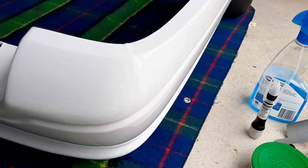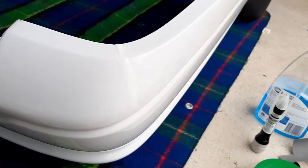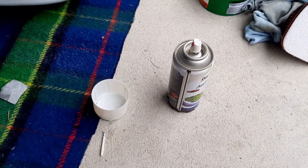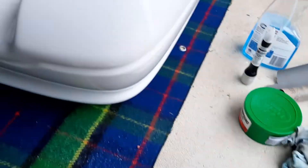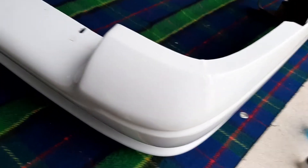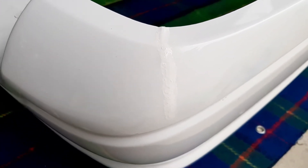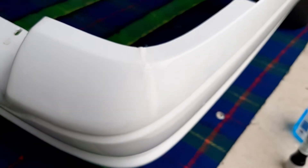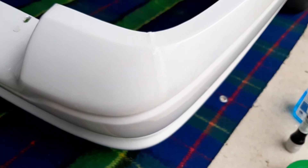The finished repair on the inside has about three cable ties and roughly six copper stitches holding it together. Give it a shake — it's pretty solid. On the outside I've cleaned up where the crack was and touched it up with aerosol — I spray it into the lid and use a little brush to apply it, put it on twice and hit it with the heat gun. In about five to seven days I'll hit it with 1000-grit until it's smooth and then polish it out.